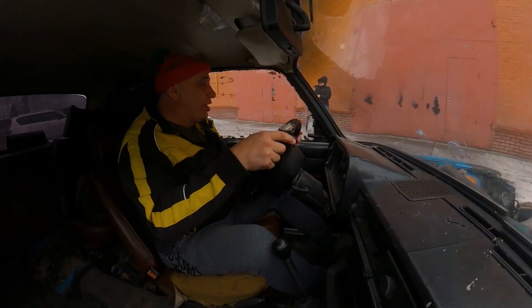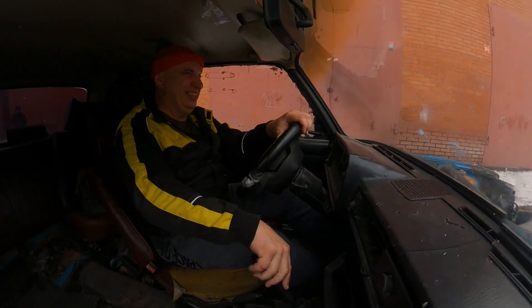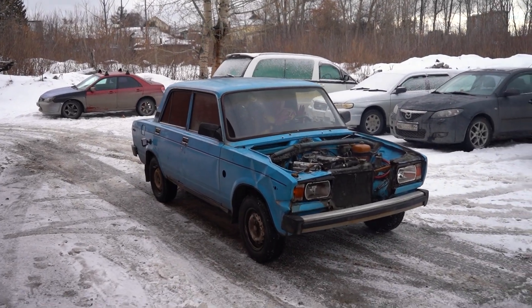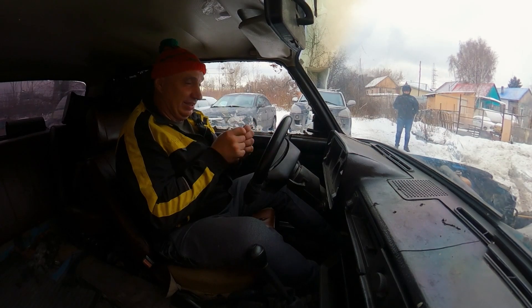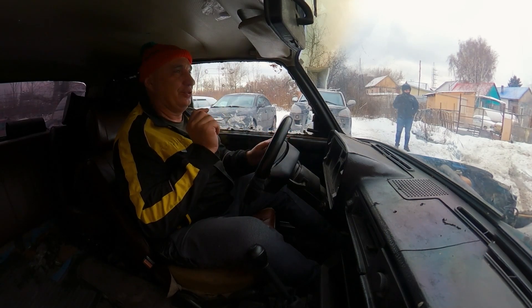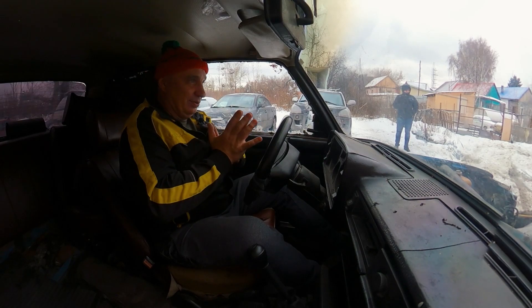Okay, the car is running. Even after we increased the travel, it's still doing the same thing. I've got the clutch and brake pedals in — oh, now it's unstuck. So apparently it's not enough to just make sure the pressure plate is not contacting the disc. Now it's all the way up and I can hear it whistling — still works though. No, feels alright. It stinks though, it is definitely slipping. When I release the clutch there is a bit of slip at first, but then it engages. I suggest we get this onto a lift again and slightly shorten the rod in order to get the pressure plate to clamp down a bit harder.